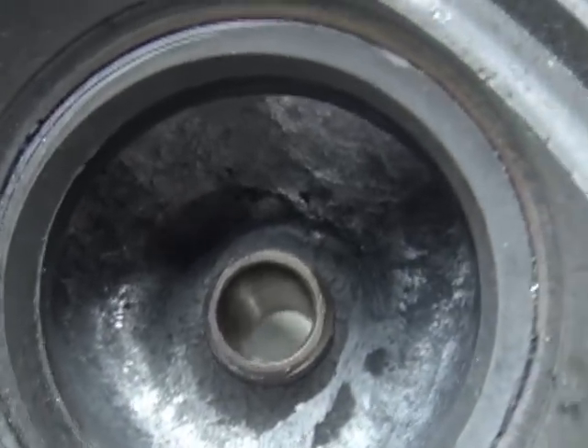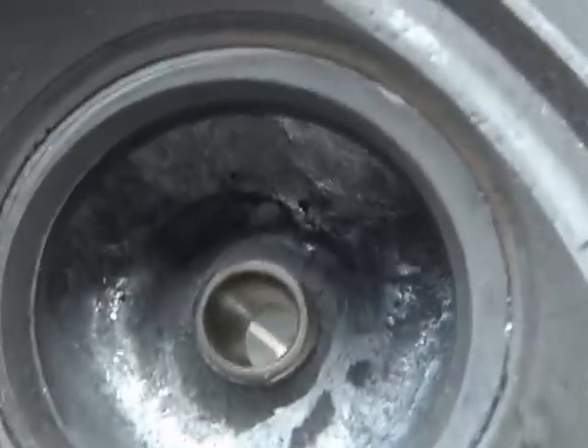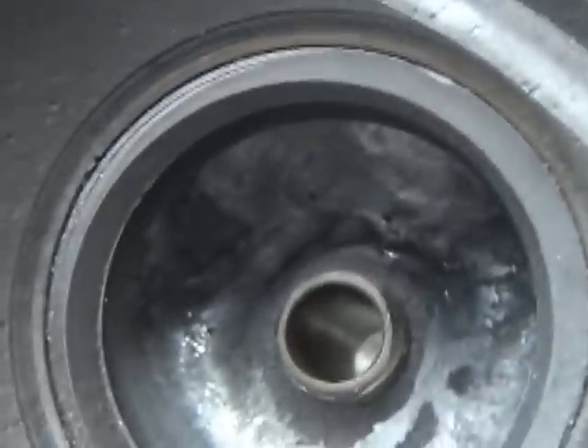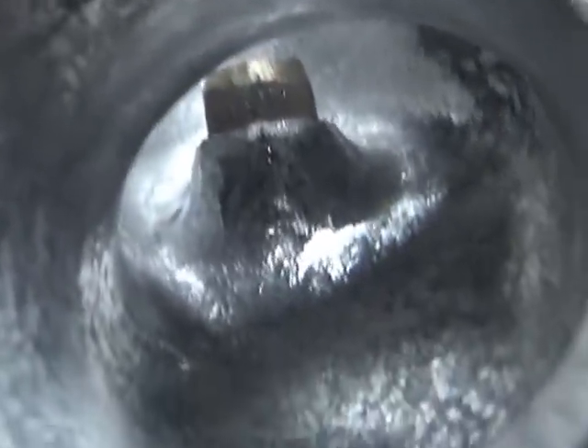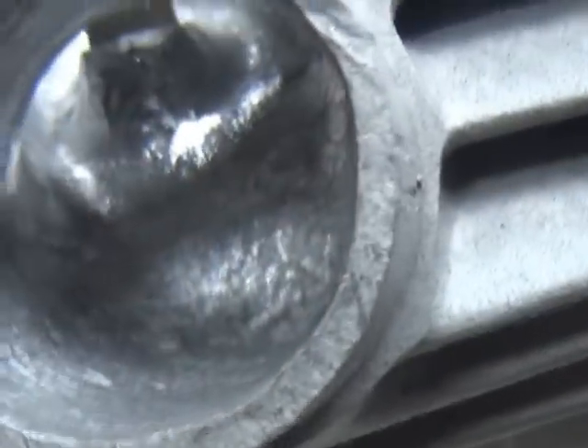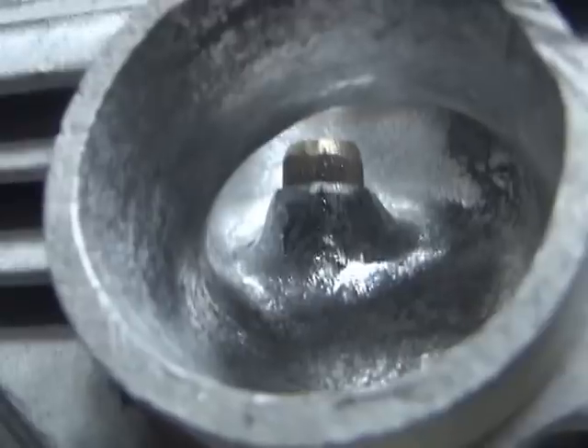It's opened out the flow down both sides of the port here. Coming through here, we cut out right through here so you can get some angle through there, get some decent flow, and make it flow around both sides of the guide instead of just one side. You can see how much bigger the area is. There was also a big hump right down here at the bottom that we took off the big square part of it, so you've got a pretty good size flow going through there.